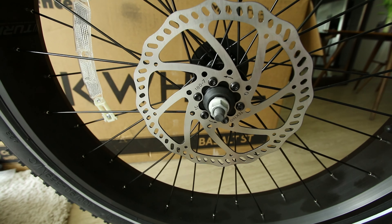What kind of torque are we working with? It's doing it from a stop on the default settings — decent. I'm going to change the intensity setting from 3 up to 5 just for the hill test. Same test with the intensity on 5, full throttle. It gave me power quicker off the line and is definitely performing a little better climbing the hill. Regardless of the exact setting, this is a strong hill-climbing bike. I'm going to put the intensity back to 3 for now, back on default settings.